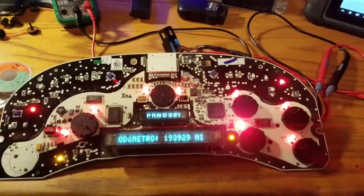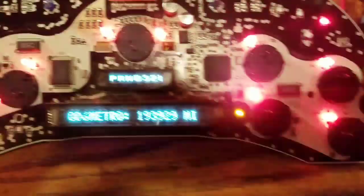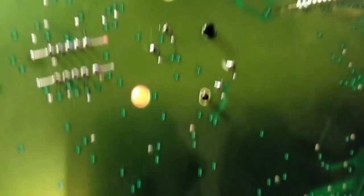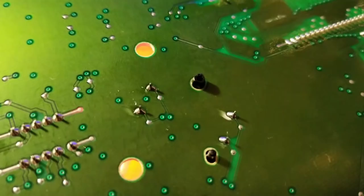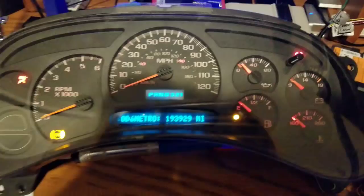It's almost midnight and I still have two more clusters to do tonight. I went ahead and put all the stepper motors in — you can see the red backlights are in. I touched up the known resistors. On the back side, I solder the stepper motor legs — I use 0.4 millimeter 63/37 solder, which takes almost no heat and lays down real nice. I'll put the front cover on, then the back cover, re-hook up the data line, and bench test the completed rebuilt cluster.